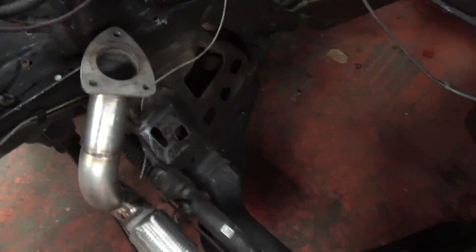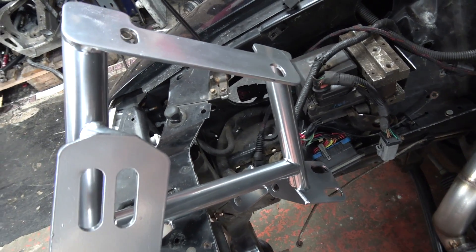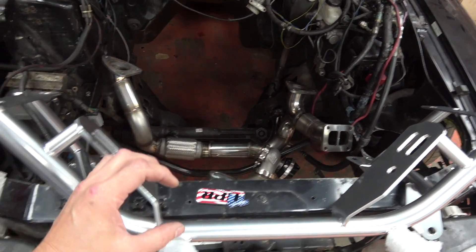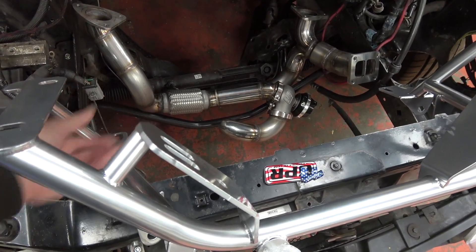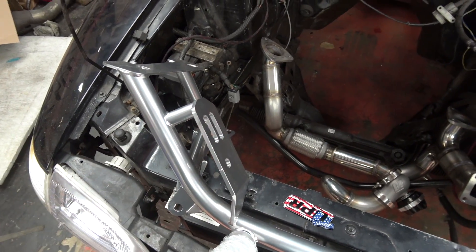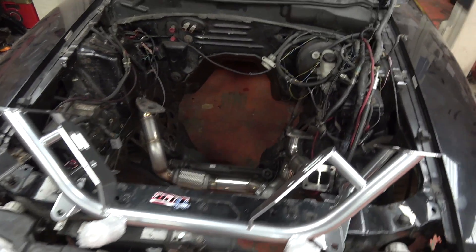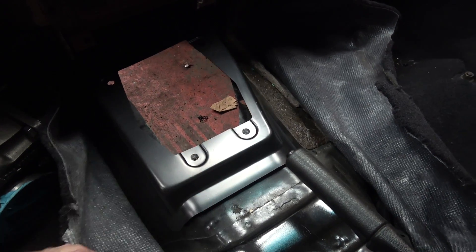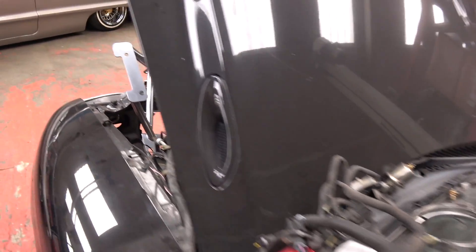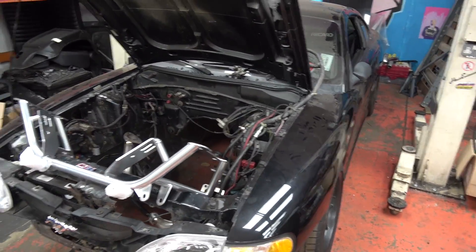As I was thinking about when I ordered this thing, it gives a lot more room in this area for exhaust. You can see the factory one there is boxed in — this one is not. So there are two thoughts at the moment: the exhaust is still going to go down low because I like the way that looks. It'll either come around the front, loop around there, twist through that hole and go to the back of the car where it belongs, or we'll chop this mount off and re-figure out the engine mount. But for today it's time to finish welding in the new manual gearbox tunnel lump, finish prepping the floor ready for paint, then I can get on with making brake lines and putting the engine in for good.